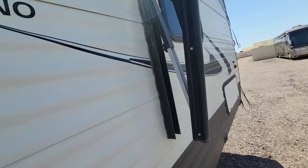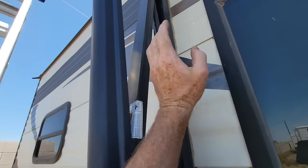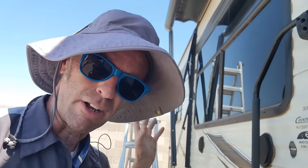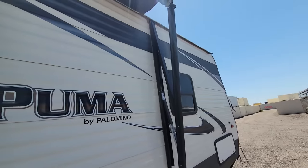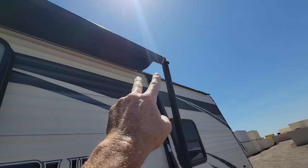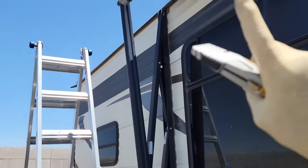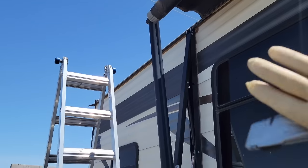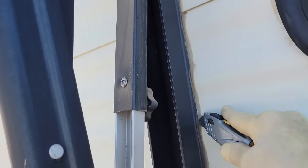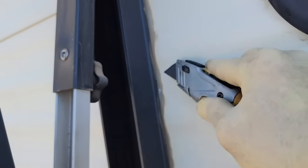All right, that should be more than enough. Now you can see that gas strut right here and the other one right here — so this wants to extend that arm out pretty quickly. You can get hurt in the face with that. I did do that to my friend once. So you don't want to take anything apart yet until you get the arm strapped down. Now the front one we don't really have to worry about because it's attached to the motor. Some people when they're doing this might just use a bungee strap to connect the top of the arm to the RV, but I've just gotten the habit of using zip ties through the arms right here.